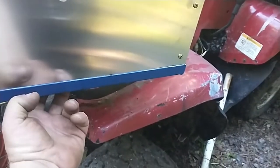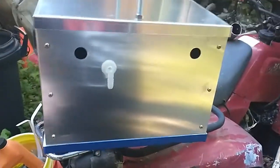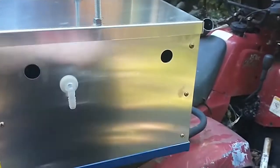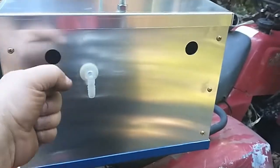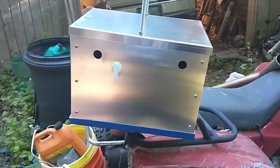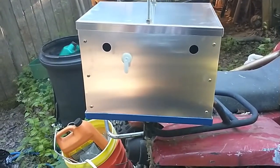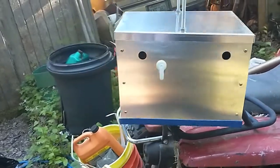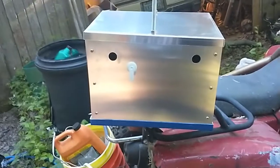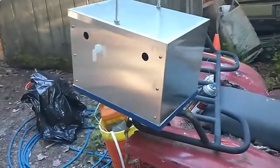Now when I wire this into the car, I'm going to run the cables that go to the car through the bottom and then through the trunk floor. And here I'm going to mount bulkhead posts, so that if the car needs jumped, you just connect your jumper cables here and here, rather than having to open up anything. I found those for 26 bucks on eBay. They're probably Chinesium, but I'm going to take advantage while I can before stuff starts to get real expensive, besides food and gas.